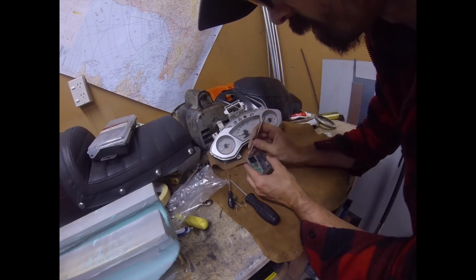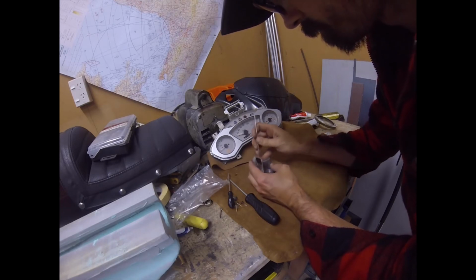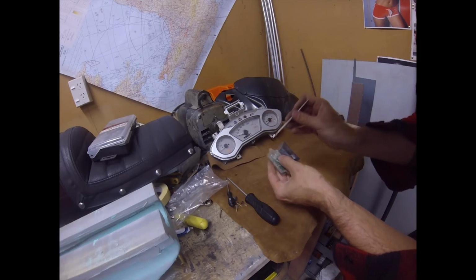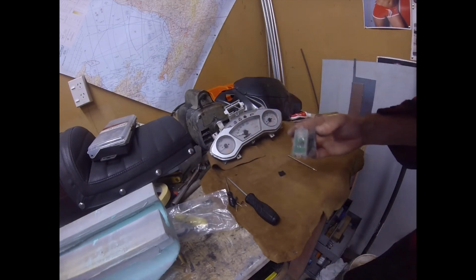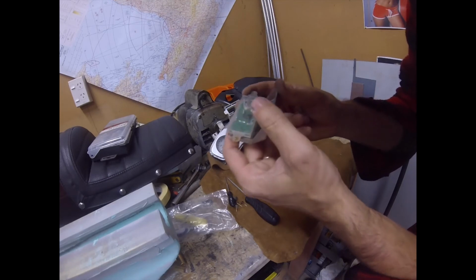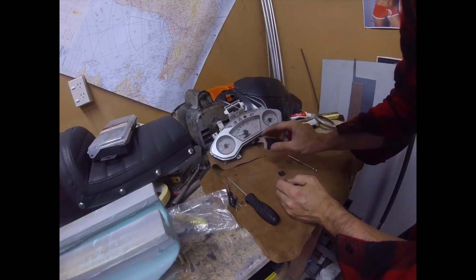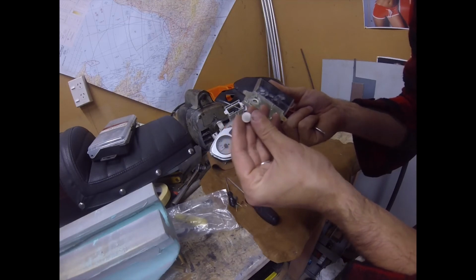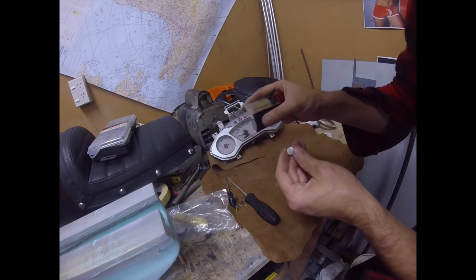If I can scrape this bit of plastic off, I guarantee there's a battery under that. And there's our little button cell. So, see if I can open that up. Just need something, a little flat screwdriver or something, to open that. And we've got a GP186 cell in there. So I'll get another one of these batteries, and I reckon that'll fix our clock.